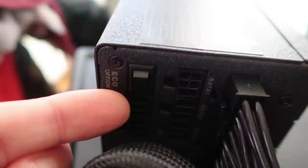Once you're all plugged in, the power supply has a power switch right here — flip that on. This power supply does have an eco mode and by default it's on, so it's possibly using less watts. I still haven't gotten a kilowatt meter, so I don't know exactly how many watts it's using, but it's somewhere between 1,350 watts and 500-something watts. The ethernet cable is going to go into your modem, router, or switch. The Antminer S9 works off of DHCP, so it'll automatically get an IP address once you connect it to your network.